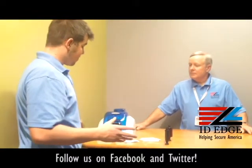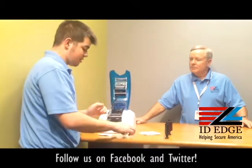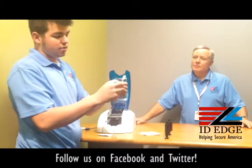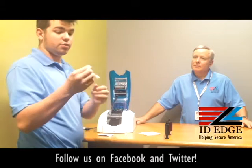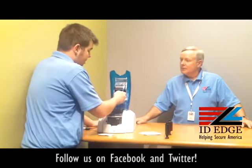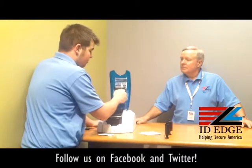After the cleaning cycle is finished, that's when the swab and the wipe will come in handy. For the swab, open up the top of the printer. To release the alcohol from the tube to the cotton, fold it and pinch it — you'll hear it pop — then give it a couple squeezes and you can feel the alcohol come out. The gunmetal gray piece up here between the two forks is the printhead. Rub the swab side to side to remove all the dirt left on it so it doesn't damage the printhead.